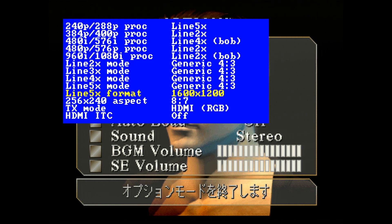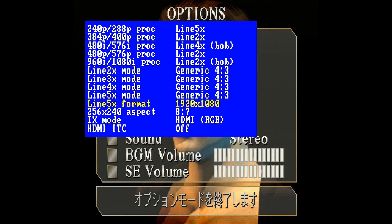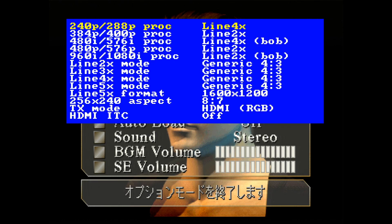You can also use 1080p mode, or 1920 by 1200, or 1920 by 1080 for 5x mode — all work fine. If you have an OSSC you already know what a game changer this is, because you can do whatever resolution and not have to change it in OBS. Every mode — 4x, 5x — works. You can capture 1600 by 1200, a sharp 5x upscale from the OSSC. But for ease of use I prefer setting it to 1080p and having all my devices output 1080p or below, letting it upscale, and then streaming in 1080p.